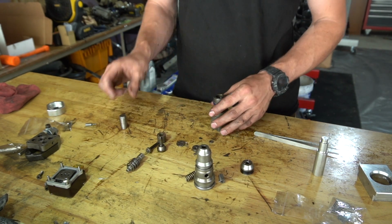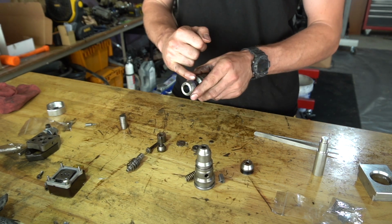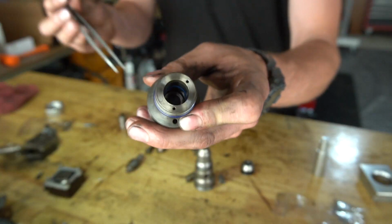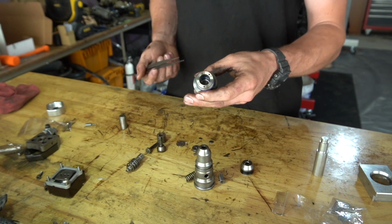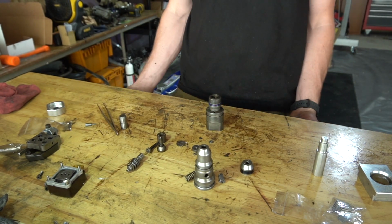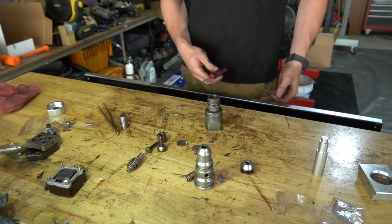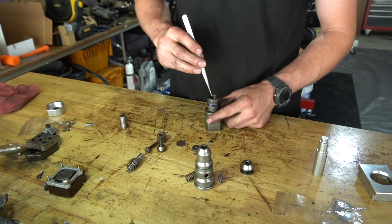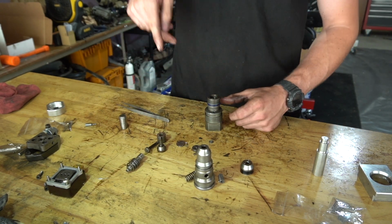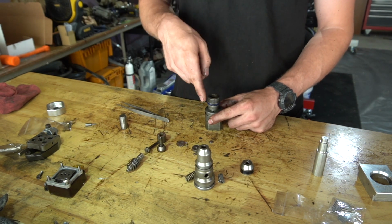So you'll clean this off, clean off the inside, and then there's 1 O-ring that sits about this height here inside. And you're not gonna be able to see it. But there's an O-ring that sits right in there. So you're gonna take a pick, easiest with the 90-degree pick, you'll get it in there, pop it out. And then if you take that O-ring, fold it and put it in there, you can take your tweezers and kind of hold it down so it slips into that recess, and then you can just take your pinky and it'll pop all the way around.